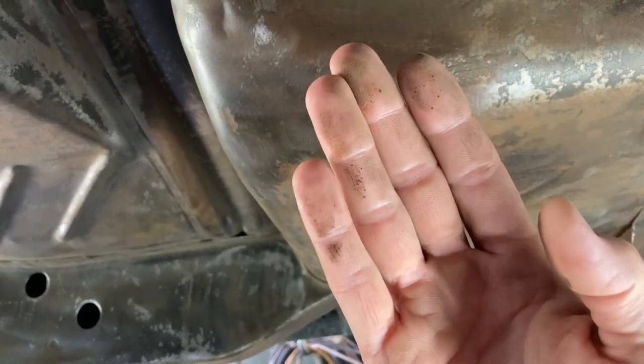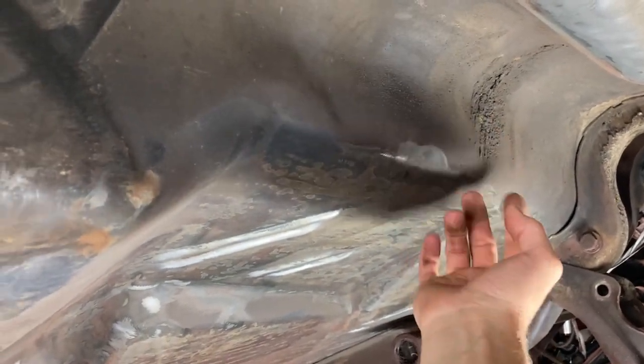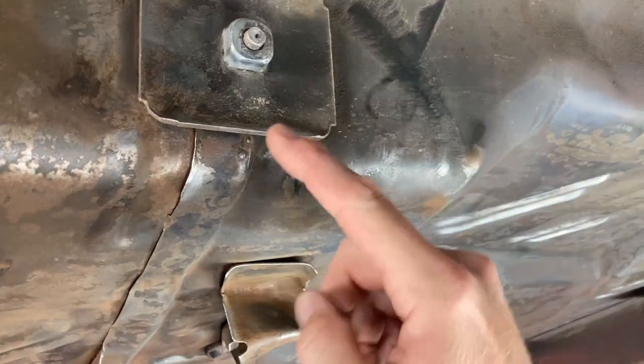See, that's still dirty like that. I left the tunnel here. See that amount of grease and funk? I was going to use a different wire brush on it and then come back with my cleaner one to knock it out. But after everything is done wire wheeling, I am going to go ahead and degrease it and scrub it all with a scuff pad just to be sure I'll have good adhesion. Prep is the most important thing for this.